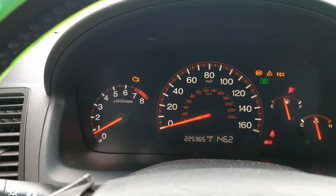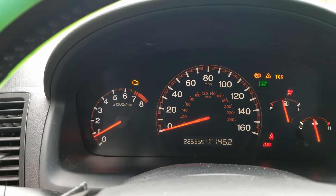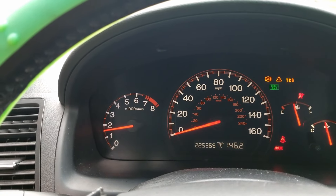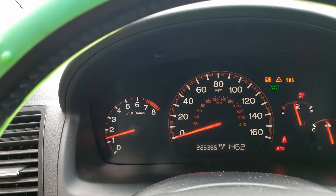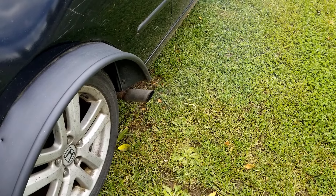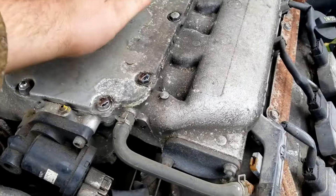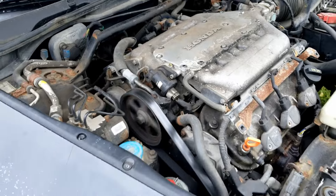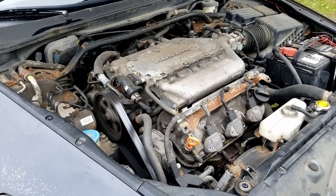The Honda is just running here — check engine light flashing. There's nothing in the cats to get wrecked, so that's probably not a good thing. A lot of blue smoke coming out of the exhaust, and that exhaust smells really oily. The compression test went pretty positive, but this old girl's gonna pop. That might make a good video.